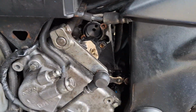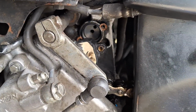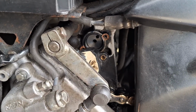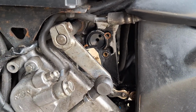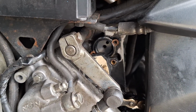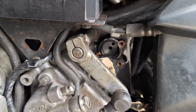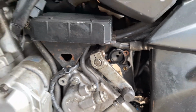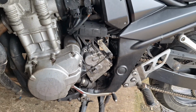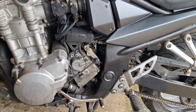One thing I would say is I would use electrical contact cleaner in there. Don't be tempted to use, you know, brake cleaner or WD-40, because they'll break down certainly the plastic and rubber that's in there. Maybe do some damage to some of the other surfaces as well. So I would definitely stick with electrical contact cleaner. You might get away with carburetor cleaner, I'm not sure, I didn't say that. But yeah, just be careful what you do spray into that.